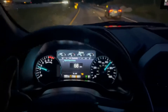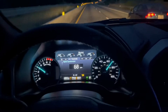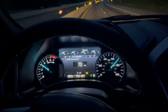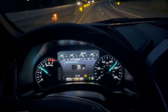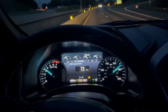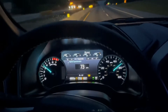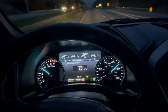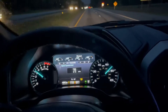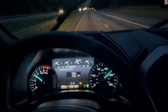Another interesting thing about this system: once you switch over to blending — say going up a hill with the trailer — it starts blending because the system sees there's not enough rail pressure on CNG. Then if you come to city driving or idle, it'll switch back to CNG if there's enough pressure at the rail. That's why you're able to drain the whole tank completely to zero — or very close to zero. I've heard you can even go into the negatives, but I haven't seen that yet.